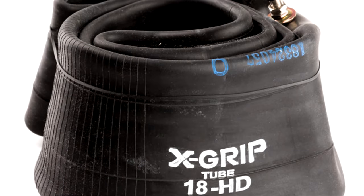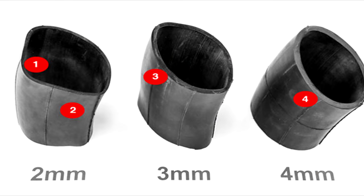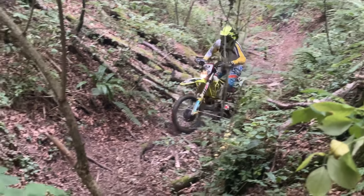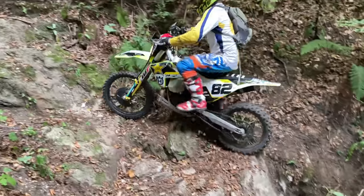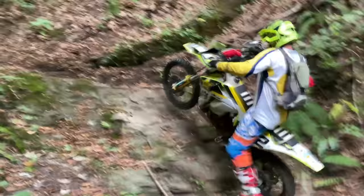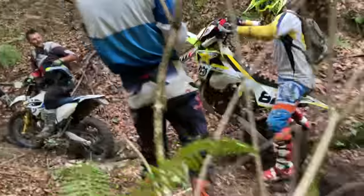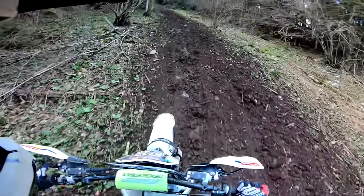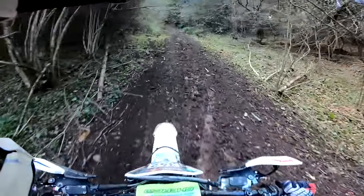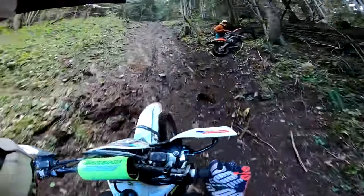The heavy duty tube is simply a thicker version of the traditional inner tube and installs just like one. These tubes are a far less expensive option than the highly priced mousse and stand up to pretty rough conditions. Many riders report never having a flat tire after installing a heavy duty tube. In my experience, I often get flats on the back wheel with tubes, but on the front tire it works well — I've done over 100 hours with no pinch flats. The downside is a springy feel when hitting objects and they are still not puncture resistant.